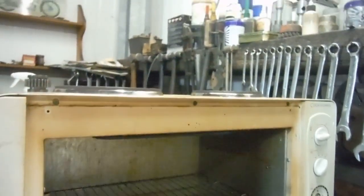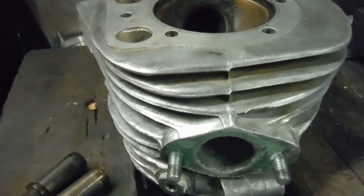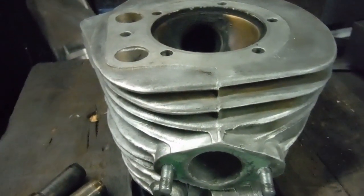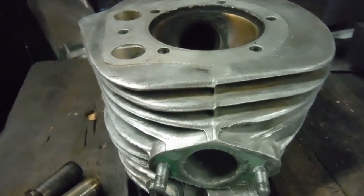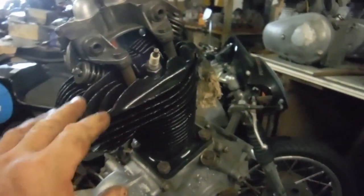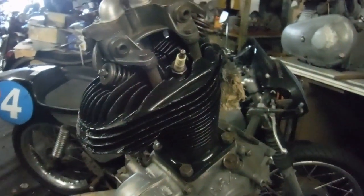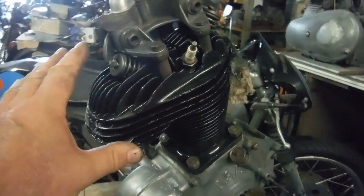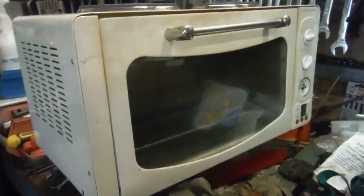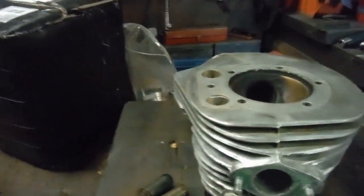I have both elements on with the heat turned right up, and no kidding — I put this cylinder head in there for 10 minutes, got it out, and the guides came out really easily. The other one I did recently was a 1930 BSA Model L engine with a cast iron head and cast iron valve guides. I had my doubts, but I warmed it up in the little electric oven and the old guides came out nicely, and the new ones went in just as easily.